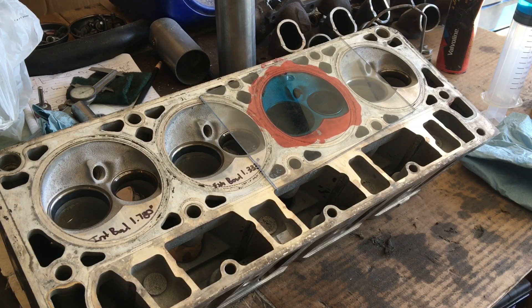I just wanted to throw out some of those bowl cut percentages and mention that I'm taking this set of heads to Nolan's Cylinder Head in Kansas City. I'm hoping to get some good information on what they're able to do as far as proportionate bowl cut percentages during a valve job, because that could be a huge time saver — plus it's better for quality and consistency, since a machine cutter is going to be more accurate than doing it by hand. Looking for 61cc, hopefully we'll get it. I'll do an update video when we get these heads back and get them finally assembled, because I want to see how much that changes when we put in the bigger valve and do the fresh valve job.